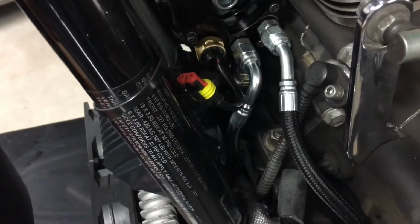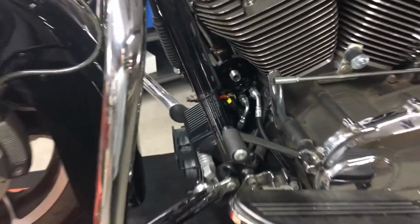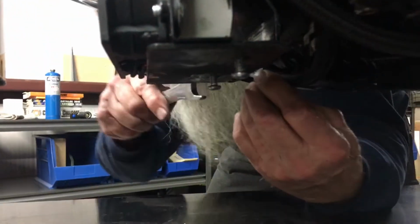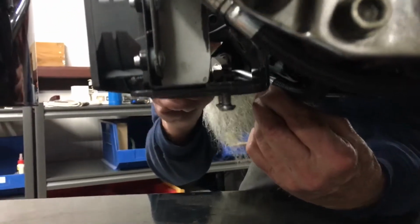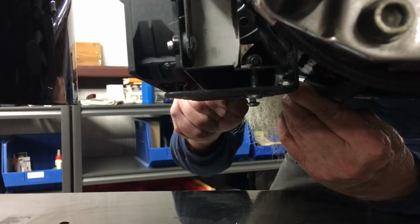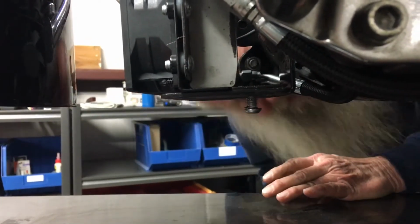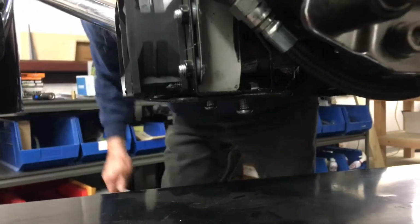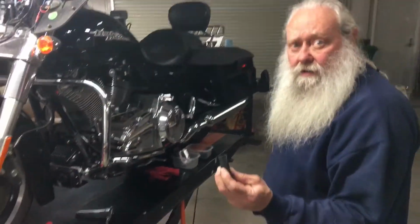On the bottom one, you can use a wrench down there. So this hose over here, I'm gonna come down here and just make sure it's not rubbing on anything. And now I can tighten this one up. And it's aluminum, so you don't have to go that tight. Okay, just snug it up. You got oil on it, so everything should be good. And if you check out your hose, make sure it's not rubbing on anything. All right, if it is rubbing anywhere, readjust it or put a hose rubber on it.